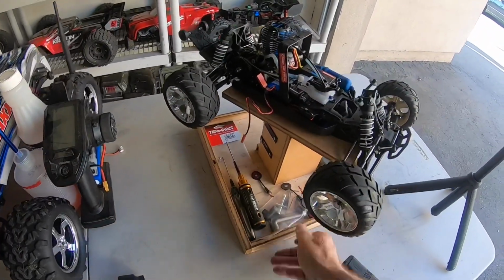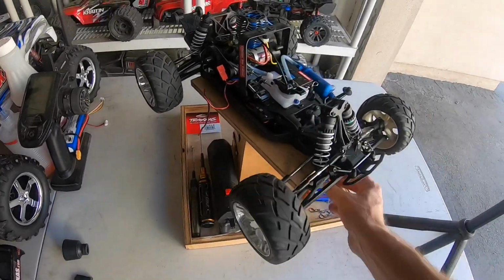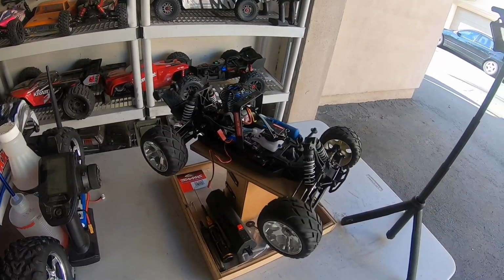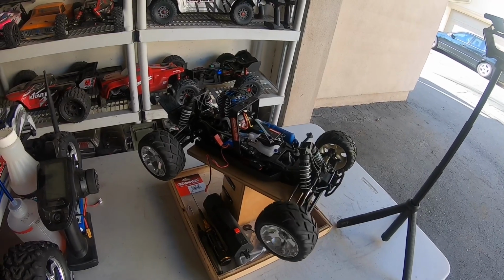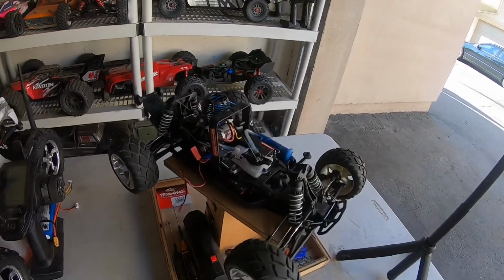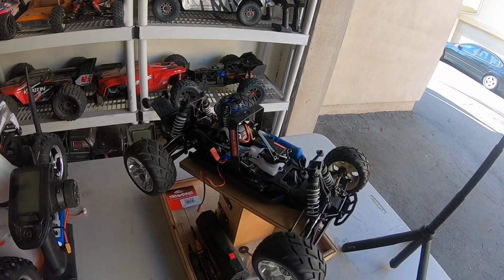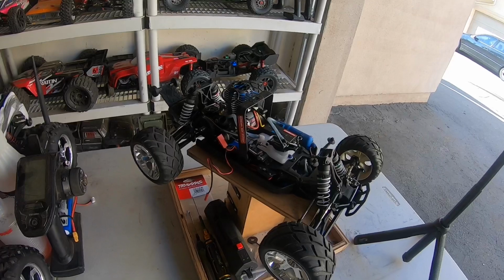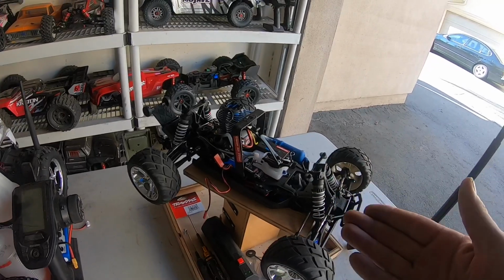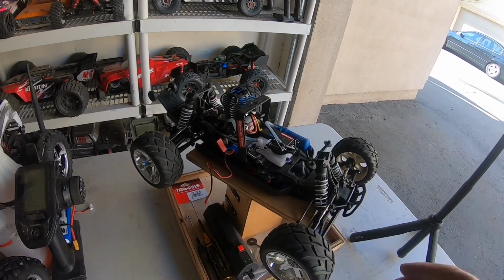I know Hybrid talked about this, and if you read some of his comments, he agrees that when you have a high idle, you need to add fuel to the low speed needle and keep adding fuel. And then when you get to that point of a double idle, where it's idling just a little high and then drops down right away, that's letting you know you're almost there on the low speed needle. And then of course the pinch test after you get it close lets you know that, hey, your idle gap and everything is pretty close.